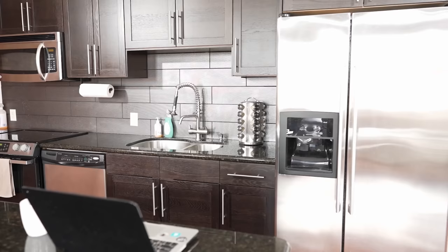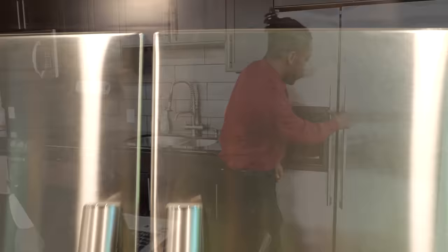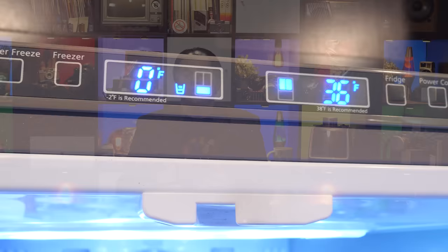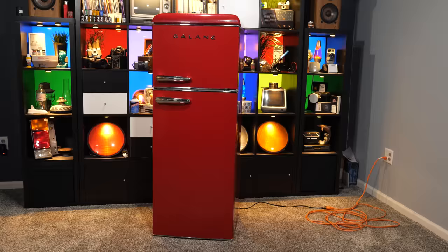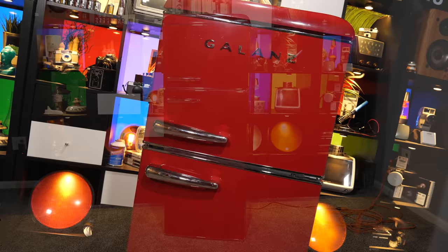And of course, we just couldn't help ourselves and we kept on adding more and more complexity. Now we like to put the freezer compartment below the fridge or to its side, and that means we need fans to move air between the two compartments. The condenser often has its own fan too, which allows us to put fridges in tight, quasi-built-in spaces. We've moved away from mostly mechanical thermostats and defrost timers to microcontrollers and sensors and relays. And now we stick TVs in them and Wi-Fi for reasons. But then there's this little red fridge.